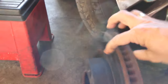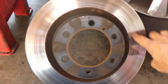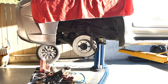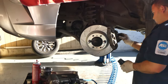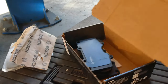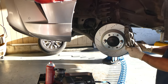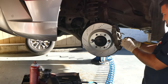A good idea before you install your new rotors - set them side by side to make sure they're the same size. The old rotor had none of the drill holes or the slots, so there was just too much heat - it was retaining too much heat. This car weighs 5,500 pounds, so it's not a small car. When you're going down a long hill and staying on the brakes a lot, there's a lot of heat being built up. It's good to have slots and drills to dissipate that. Now we slide in the brake pads - we went with the Bosch QuietCast pads. They seem to have good reviews on Amazon; I'll let you guys know how they do over the course of time. The pins will go back in along with the springs and we'll be back in business.